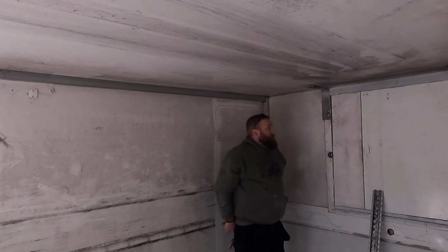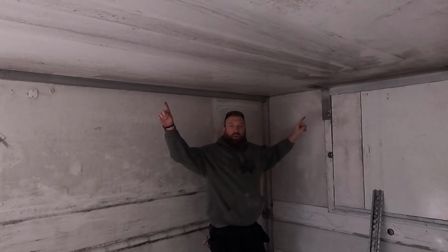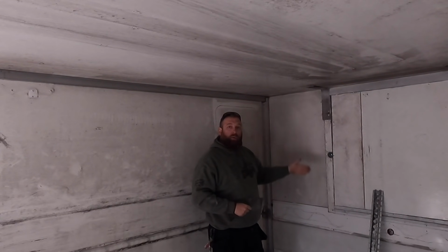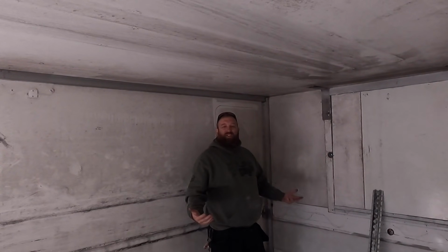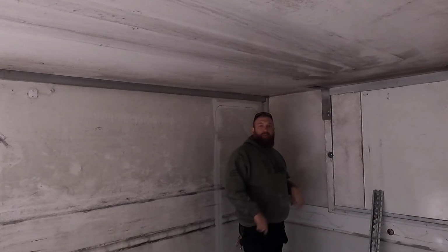The other thing I need to do at some point today is for the outside of this end wall, I'm just going to measure between the trims. I'm going to get the aluminium composite and completely board that so it's a nice fresh finish. I'll glue that on, stick a few rivets about. It just tidies it up for paint, if that makes sense. You can't then see where I've patched and holed and stuff.